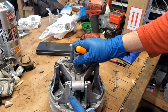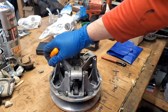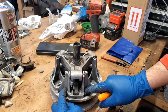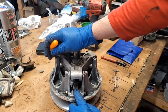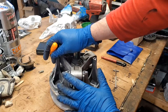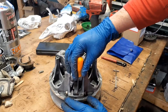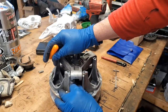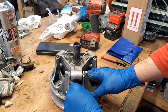The other thing to check is your weight itself. Now, I mentioned before that I have kind of a hybrid system going on here. So there's different kinds of bolts here. There's some weights that are fixed to the bolt, so that the bolt doesn't pivot, the bolt pivots with the weight. And then there's also weights that have a bushing in there. Well, long story short, I made a hybrid system when I got this new clutch, because I didn't really want to pay for new weights and things like that. So I got it to work with how I could. So I found some spacers that fit in between here properly so that I don't get excessive movement. And I don't have a bushing in the weight there. So this weight will wear out, and we're starting to get to that point, but I'm still in decent shape.